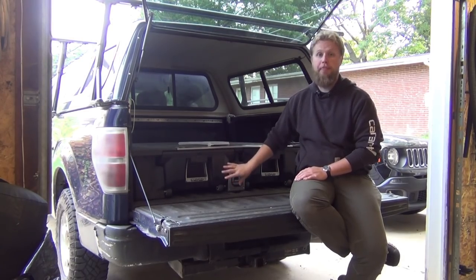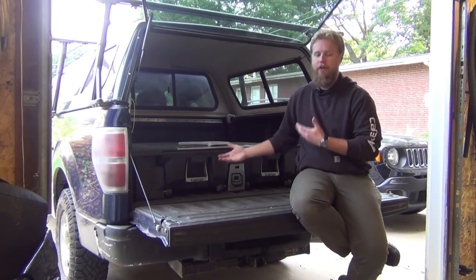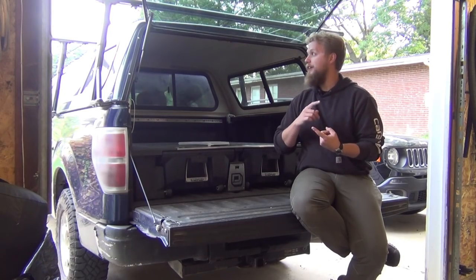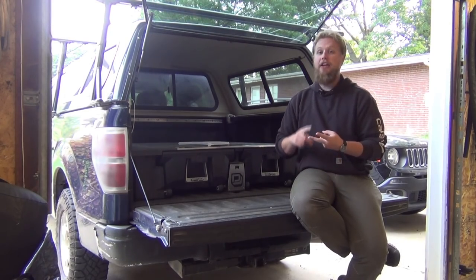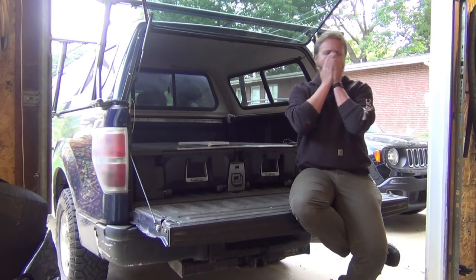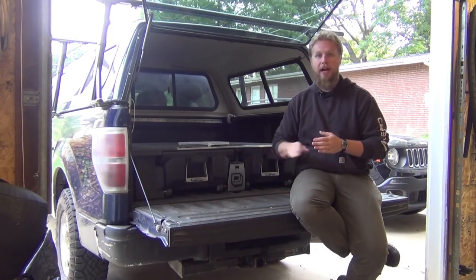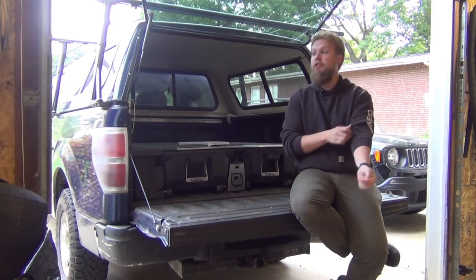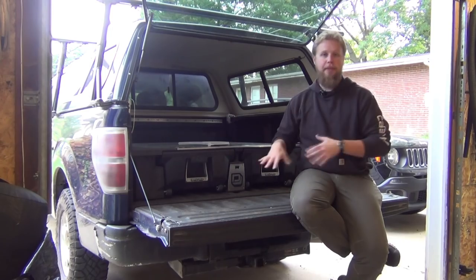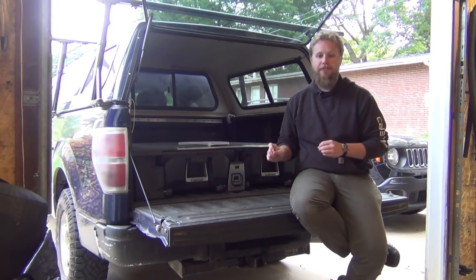It does also add another 200 pounds of weight in the back of your truck. Not only that, you're going to have all this space in these huge, voluminous drawers that you want to load full of stuff. So now you've got to start thinking about the rear suspension of your truck. I've got probably about 150 to 200 pounds of topper and 200 pounds of drawers — let's guess 50 pounds of gear in each drawer. That's a lot of weight in the back of my truck. My stock suspension, which in this F-150 is a little wimpy anyway, is completely level now. If I hitch up a trailer I start really dipping that rear end. I am doing an aftermarket suspension that'll accommodate for that weight, so ultimately it's not a big deal, but it's a thing you need to be mindful of.